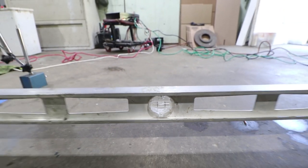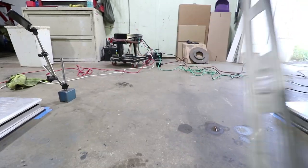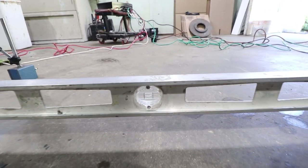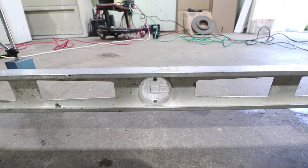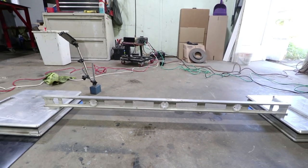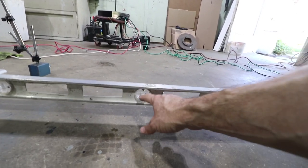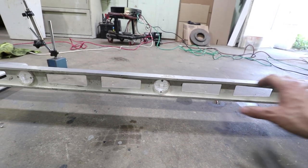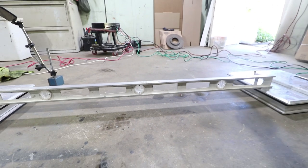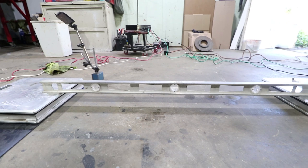And then if you do use a level, it's always good practice to swap it from end to end and see if there's any differences. Still right between the lines. So both methods agree. My feeling is that the tape measure method is more accurate, because if you think about the positioning of this bubble inside this long frame, it could be off by a fraction of a degree, whereas measuring at the ends, there's no measurement error. It's basically you get what you get, there's no error.